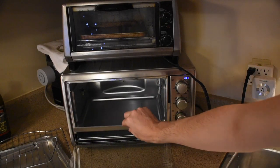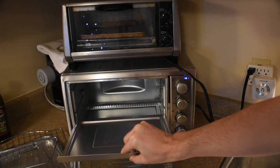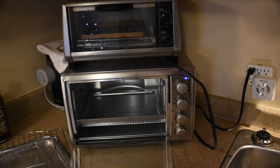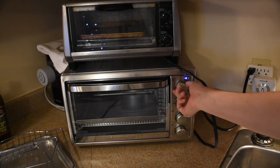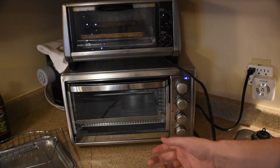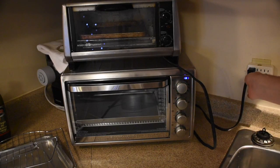It does come with an anti-drip tray to protect the bottom elements. I would leave this tray on the bottom to make it last longer. One tip: never turn the time dial back against the motor direction. The temperature dial is fine to turn back. So if you are done with something early, just turn the temperature down to zero and let it run out, or unplug it. Turning the time dial backwards could damage the motor inside.